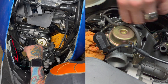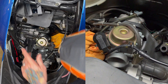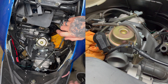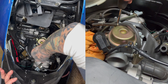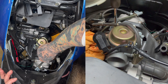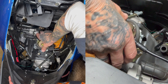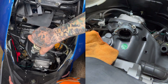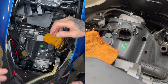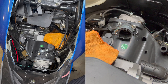What we have left here is the intake. We'll take the intake off, loosen that up. Usually you can just give it a little twist and a tug, and it comes right out just like that. Now you don't want to turn it over because there might be a little gas left in the carb — there will be some fuel in there, especially since we did try and run it.